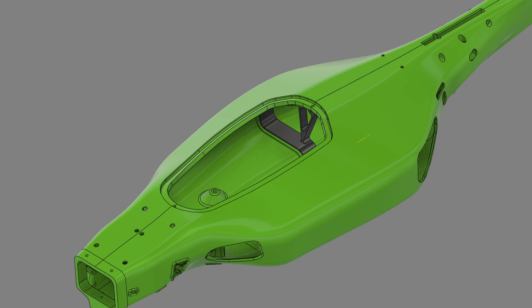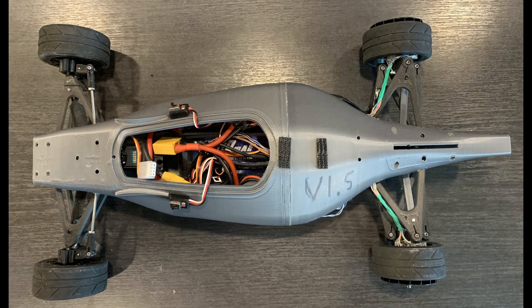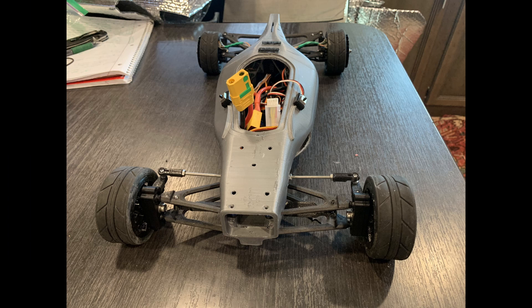Let's move on to the actual exciting part of building up a working test car. This initial monocoque was not meant to be run as a car — it was just a fitment and strength test monocoque. But as I got into it, I really needed to get this thing out there and running to see if there were going to be any other issues. It was hacked up pretty good with manual modifications, and it didn't have all of the provisions for mounting the steering servo or the shock absorbers. I also had to combine two different versions of the suspension because of changes in the monocoque, so one side is actually a little bit narrower than the other side. I ended up in my first test session having four degrees of toe-in on the rear suspension. Nonetheless, I knew that running the car would be a great learning exercise — so I drilled some holes, zip-tied in a servo, and stuffed everything into the far too small monocoque. It took me over an hour to just assemble the rear suspension, which is completely unnecessary.